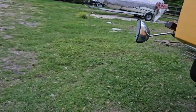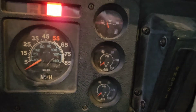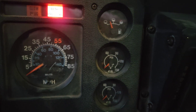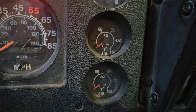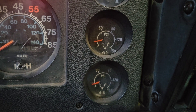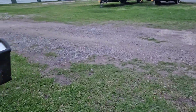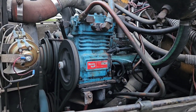This thing is completely empty right now. We'll go ahead and crank it up, do a cold start, and you can kind of see — we're right there at 500 RPMs, a little bit more than that. We'll go ahead and crank her up. At idle you'll see here in a second the gauge — it'll start rising. Yeah, there we go. It was never this fast with the old compressor, never ever. So that's our new air brake compressor. It's not common to see a TF-550 on a DT, but there you go. Thanks for watching, y'all.